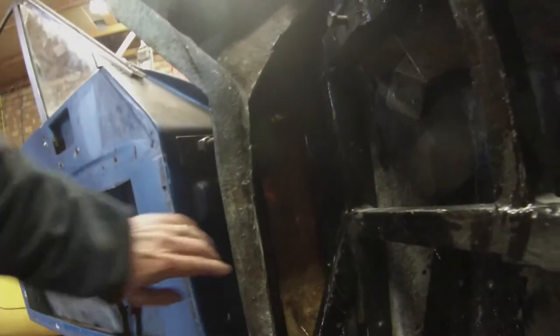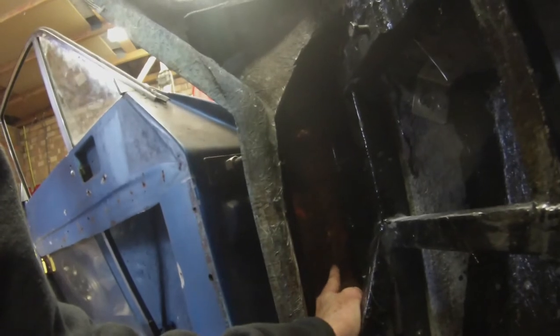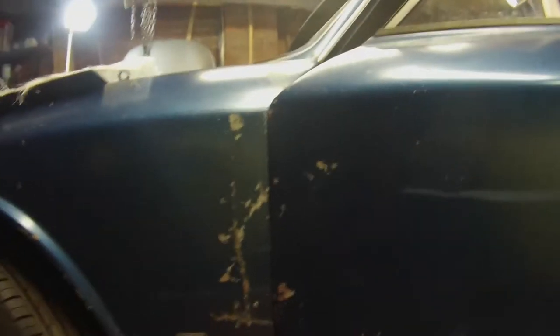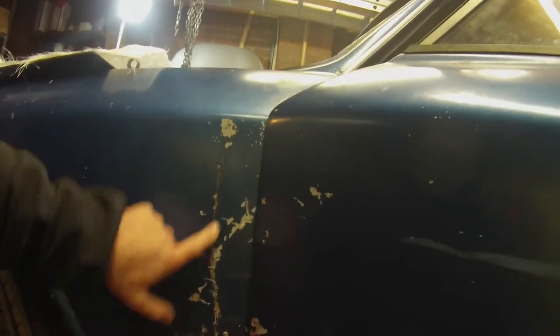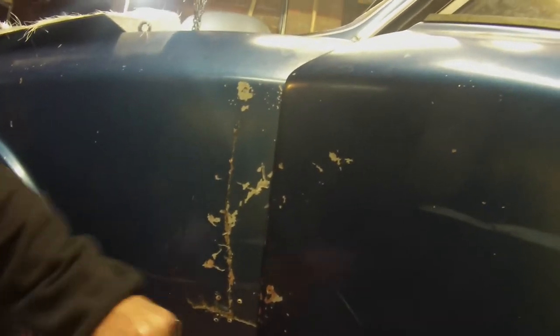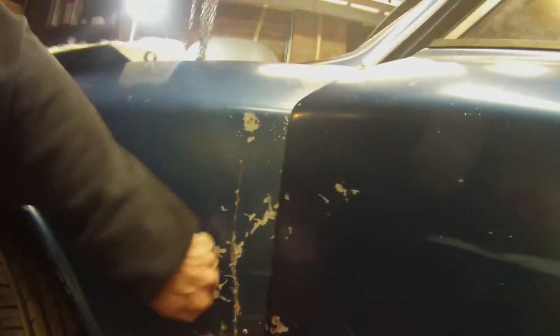While I'm at it, I'll show the back view - you may not be able to see it clearly, it's a bit dark. This piece here I've also laminated on top of because I've done the initial stage repair on this damage. I've also taken out the support alloy piece that was previously there - something obviously went into that in the past, nothing to do with anything I've done. So I've laminated behind and now I'll be able to grind out the front before filling it in neatly.